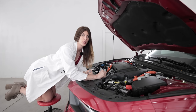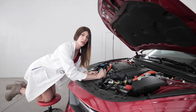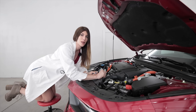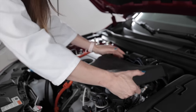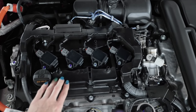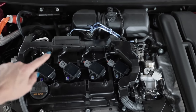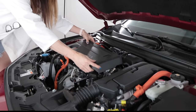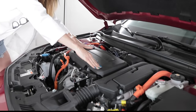It's not a ton of power out of a 2-liter 4-cylinder, especially one that has i-VTEC. Digging in a little bit deeper on the internal combustion engine: it is 1,993cc's, with an 81 by 96.7mm bore and stroke, as well as an impressive 13.9 to 1 compression ratio — super high, that's like Mazda SkyActiv territory right there. Underneath this plastic valve cover, it does employ Honda's i-VTEC system, which is variable valve timing on the exhaust and intake cams, used to simulate an Atkinson cycle by closing the intake valve later on the compression stroke.